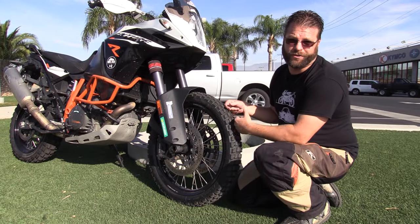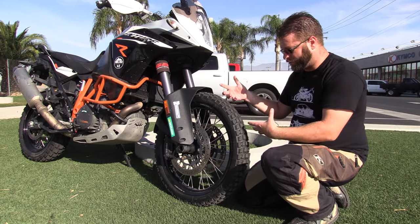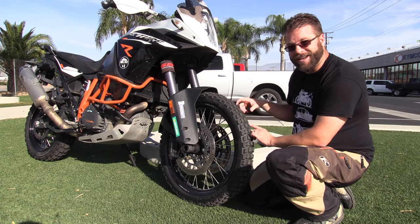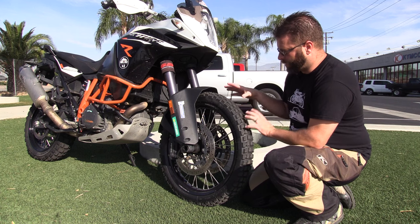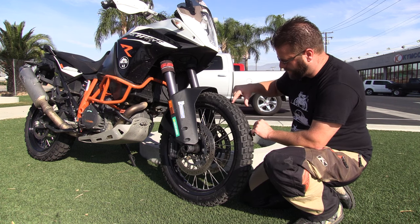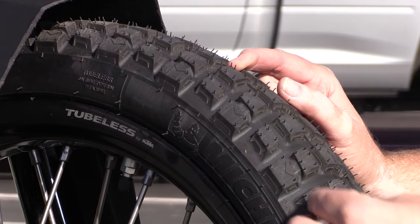The current year is 2019. There have been lots of tire manufacturers that have copied similar technology to this tire that came out in 2016. But back then, this was extremely revolutionary and nobody had seen the likes of it previously. What they've done here with the tread blocks is they've actually siped out the sidewall of each of these blocks, which allows each block to actually move independently.